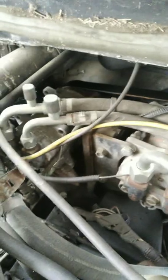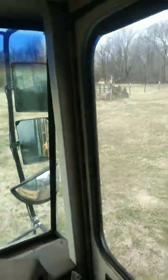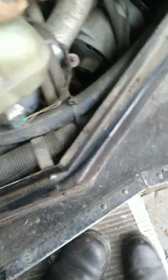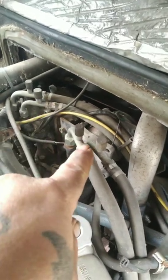Here's something I just found very interesting — I've got two AC compressors on the motor. Pretty cool. One of them obviously is not working. These are the hoses I've got to trace down to see which set goes into that back unit. I believe it's this set here, because this hose over here goes that way and comes up this pillar through to this unit. I've been disconnecting underneath, so I've got to trace it down and make sure it's the right one before I disconnect and pull them out, since one still works.